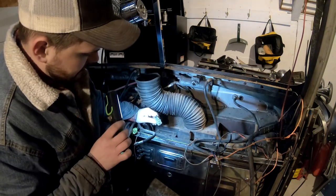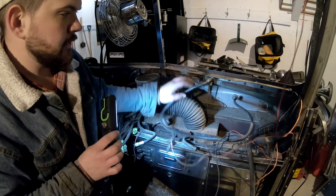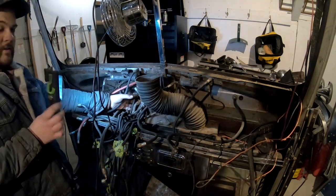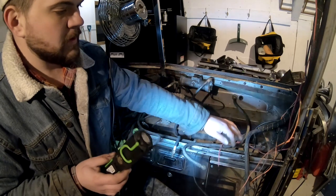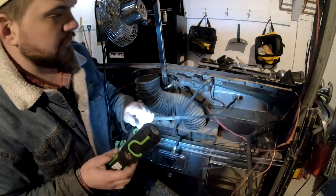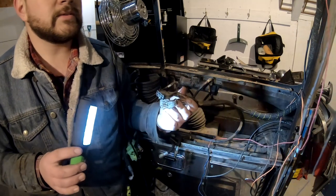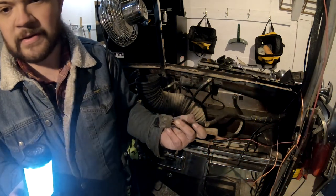This is the plug for the HVAC from your main harness. This line is additional - it is for the PTO, and I believe it can be slotted into one of these unused ports in the manifold, though I'll have to double check that. We're going to plan on it being moved from here over to the manifold because this was a real pain to deal with. This harness goes not only to your speakers, spotlights, and radio, but also ends up going to the bunk as well.